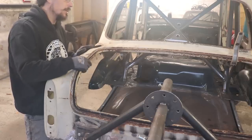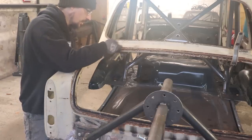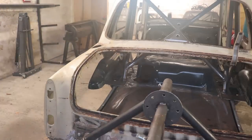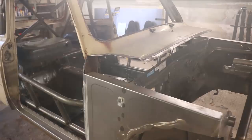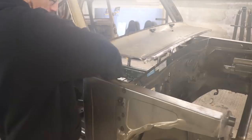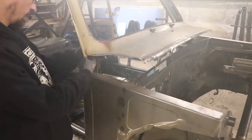So the boot will seal onto that — I think that's probably going to be the easiest way to get rid of all this, because this seam is going to be all rusted where these two panels join. I'll leave it on there for now and look at that later. Don't know what's going on with the camera, looks like I've got some fog in the workshop. But I'm going to cut this out so that you can blast right down into this pillar, and I'm going to cut a little bit more of this out so you can get right up into the pillar as well.